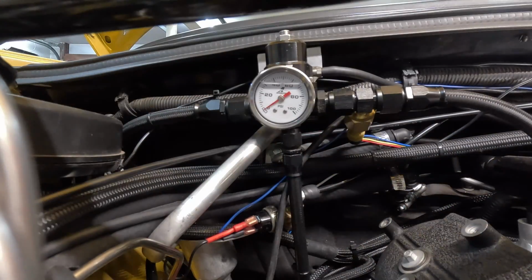And like I said, we'll see if pressure goes up, and we will also see if there's anything stuck in it, and maybe this will help get it out before we go digging into the tank. So let's get the power probe set up. I'm going to have you guys watch the pressure, and we'll see what happens. Single pump, second pump. Single pump, dual pump. You can hear the difference. Every time that circulates, it goes up to 63. And then it drops right back down to 0 still.